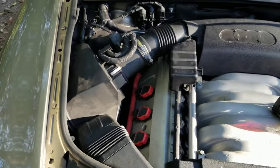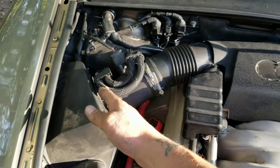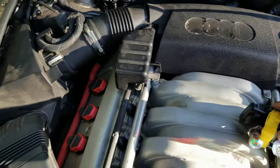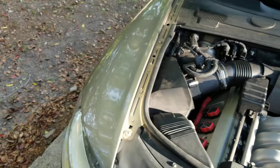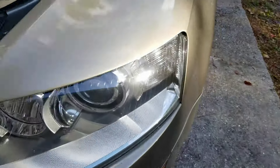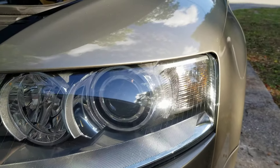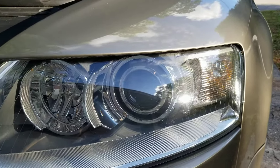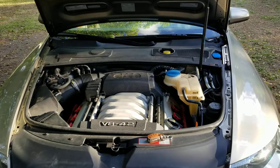She's all put back together. I didn't want to start it up until I had the intake on, because if you run it without the mass airflow, you'll trip an engine light. As for these fancy bulbs, I'm going to have to make another video on changing out those corner lights — they sit really tucked in there. I should be able to just reach in and grab them; I was probably grabbing at the wrong spot. Let me start her up and see what the indication tells me.